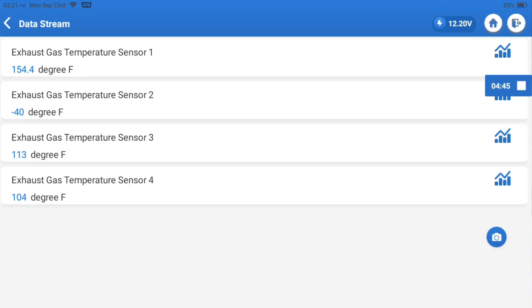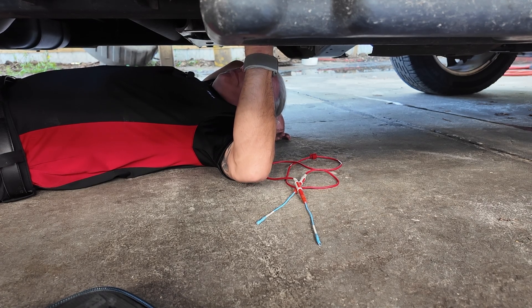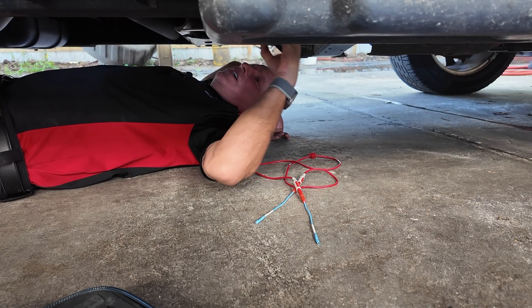I've just made a loop with two flat blade jumpers. Looking at the scan data, we see it's right at minus 40 degrees. I unhook it and it goes back to 1832. I plug it back in — no change. Pretty straightforward: looks like we've got a bad sensor.